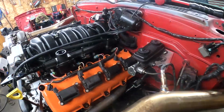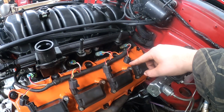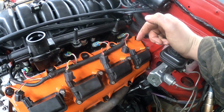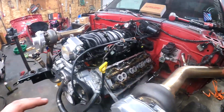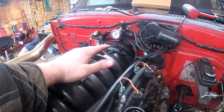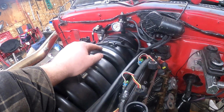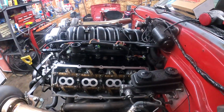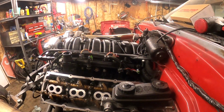Granted, one of the things that Keith mentioned is that number 5 was one of the cylinders that blew up, and that it might have come up and smacked a valve just enough to bend it. I continued to have GoPro issues today. I was letting this charge because the battery died. I was feeling the intake runner, and number 5 was hot. Keith asked if that was the one that blew up, and it was. So we were a little nervous that it nicked a valve, but instead of ripping the head off right away, we decided to check something first.